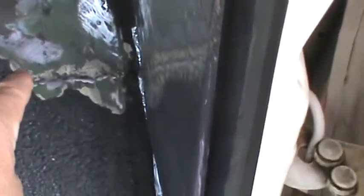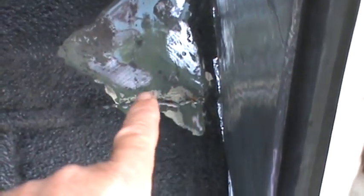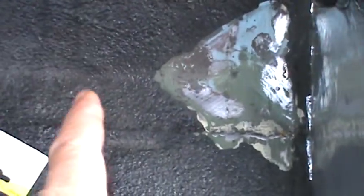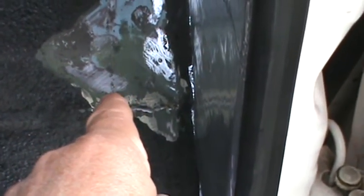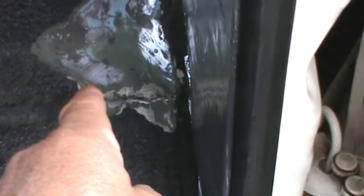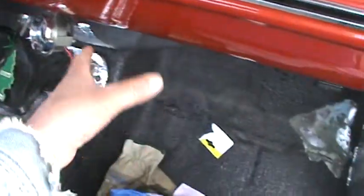As you can see right here, there was some seam sealer, and one day sitting in my truck I looked down and saw a crack going through the gator guard. Apparently it didn't bond where the seam sealer was. What I'm going to do is make sure it's good and dry — I've already sanded it down with 40 grit — sand a bit more around it, then reshoot it, masking everything off and respraying just the floor.